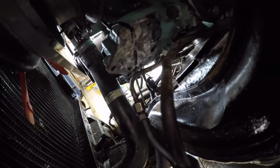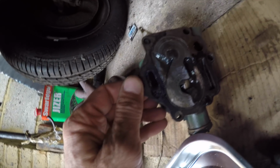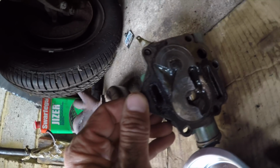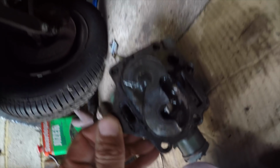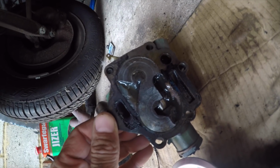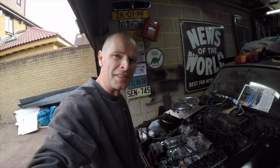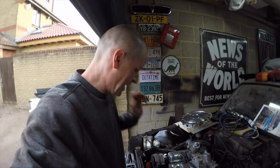It's not as neat as it was previously, but then last time it was the other way up on a bench and not trying to fall out on my head. The pump cover, oil was going through it because you can see the little Vaseline remains mixed up in with actual oil, so it was kind of working at one point at least. So let's rebuild it.